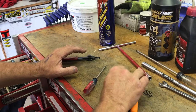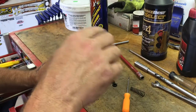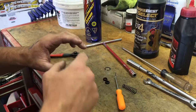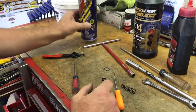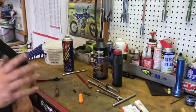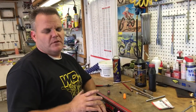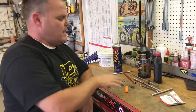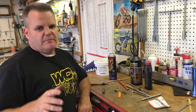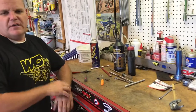With those tools, when you go to assemble it back together, put a little bit of brake fluid on these seals. After you clean off the inside of the master cylinder plunger area where the plunger piston would go in, contact clean it out and then put some brake fluid in there so that it flows easily. That's about all there is to it. This would be about the same on almost all current bikes with a disc brake master cylinder front. This is the same as a current Honda — this '03 has basically the same brake as a 2018. Simple deal; the All Balls kit is pretty inexpensive and an easy way to do it.